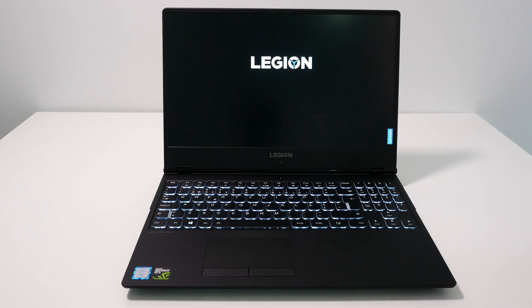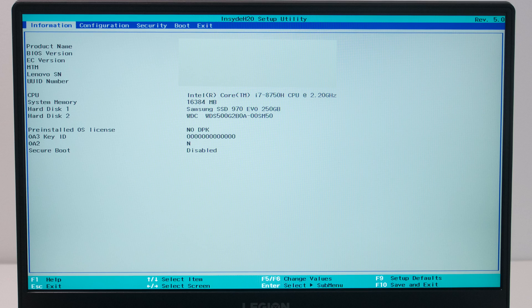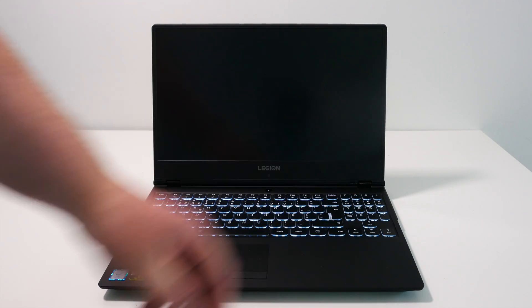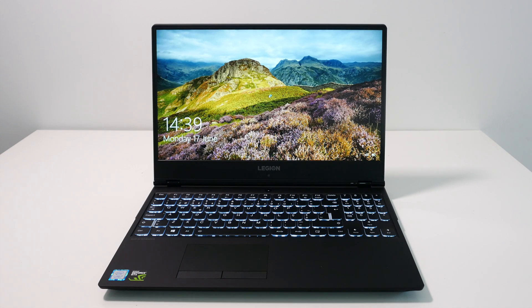Immediately after turning the laptop on, repeatedly pressing the F2 key should bring up the BIOS screen. Under the information tab, you should see the new drives listed next to Hard Disk 1 and Hard Disk 2. Once you've confirmed that the new drives are showing up, you can press Esc or F10 to exit the BIOS. If you've just added a second drive, you can boot straight into Windows. Or if you've just upgraded the SSD, you'll need to boot from your USB drive first to install Windows to your new drive. That's it for this video. Thanks for watching.